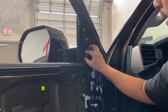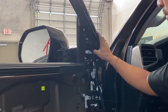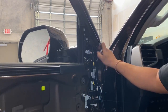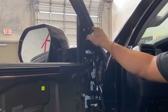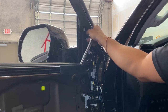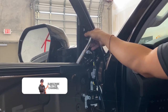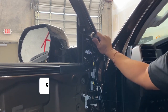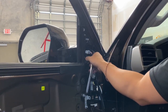I like to go ahead and tighten up with my fingers first, and then hand tighten it with the ratchet set. Avoid using an impact gun — if you do, you might over-tighten it and it might actually break off the stud. All you do is hand tighten it with just a little bit of force, and that's about it.